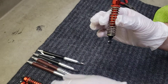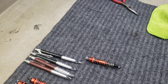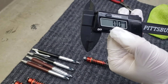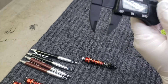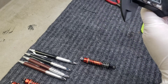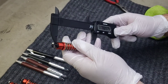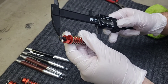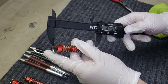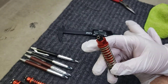This one's already done. Let me measure them for you — I think these were 100mm shocks. Let me find my digital caliper here and re-zero it. So these were pretty close to the stock length of the Gen 8 shock — like a millimeter difference or so, maybe a little more. At 87mm — so these are almost 90mm. I think the Gen 8s were like 90-something millimeter. With the pin spring mod, this brought me about to the stock shock height of the Gen 8 shocks.